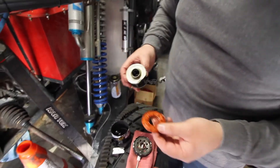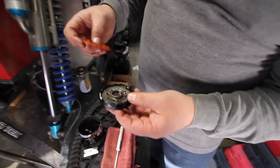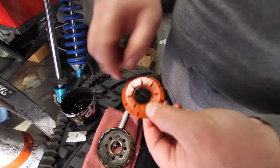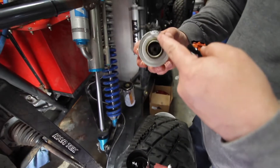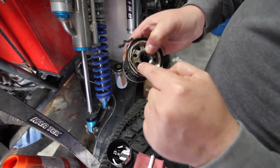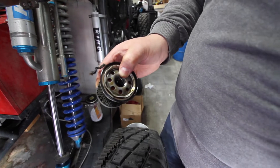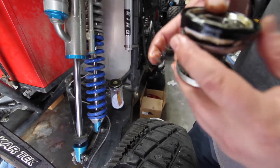There's also an O-ring design so dirty oil from the inlet holes doesn't bypass the filter media. This area acts like an O-ring fit — the larger diameter forces against the seal, separating the inlet from the outlet. This forces the oil through the pleats and out the center. Cool design.